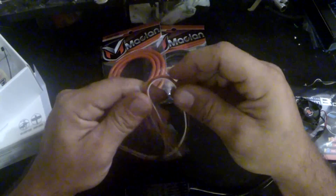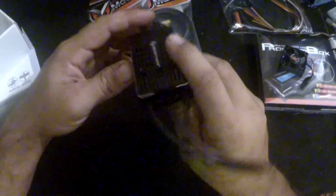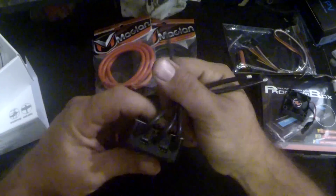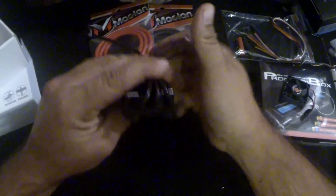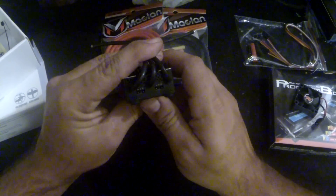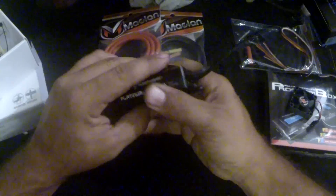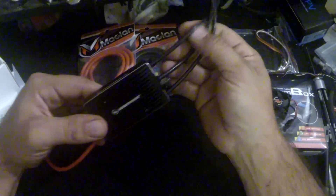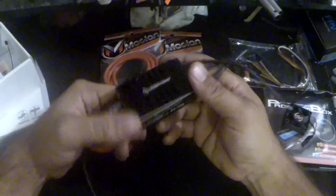I guess just to link the throttle because they're plug-in. Oh, that's cool — they plug in instead of being hard-wired in. I really like this. The whole wired-in thing is just kind of crap on a speed controller this big. I've definitely damaged them before and replacing them becomes a pain. So you can just change your wire out like that with an extension. Perfect.